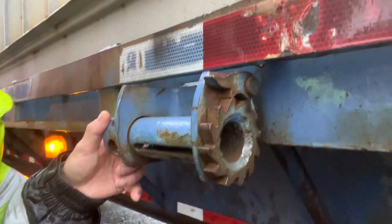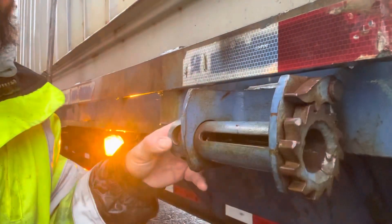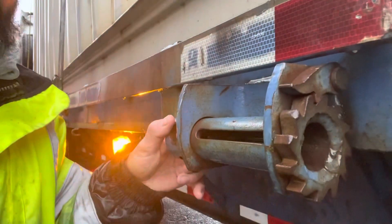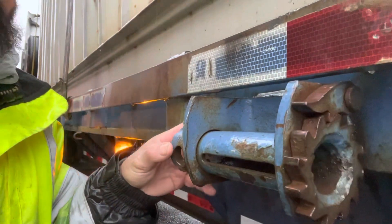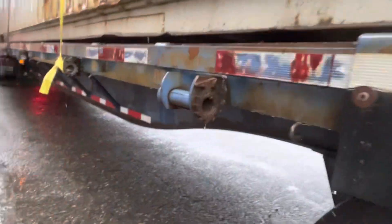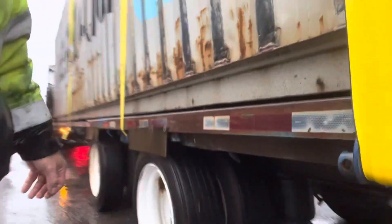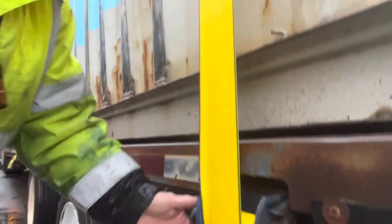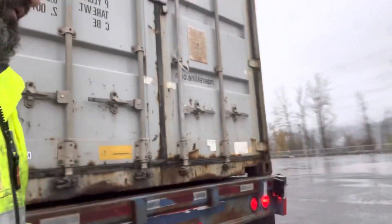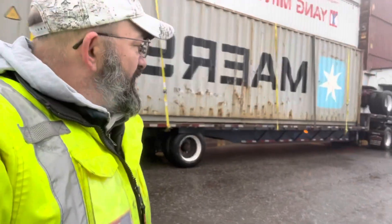You put a strap in this hole. The ratchet is attached to the frame of the truck or to the side rail. I've probably strapped thousands of these straps down. When you put the strap in there, you twist, twist, twist and it latches and locks in place. Then you use the crowbar or bar to tighten very, very tight and put a bunch of pressure on the straps. The trailer comes with multiple ratchets like these. This is the last strap on the end — this is how this container is going to be secured. We'll be hitting the road after I add a couple more straps and chain down the back.